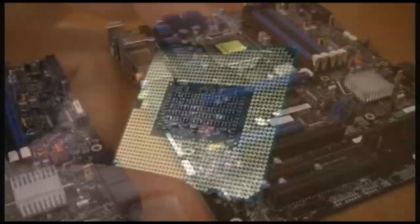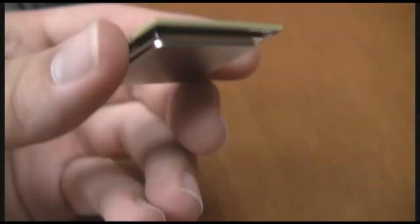Tell me about this new chipset and new socket — give me a rundown of what's going on with P55. So with P55 it's a whole new chipset for a whole new family of processors. It's also going to be branded Core i7 as well as a flavor of Core i5, and it's a new socket, LGA1156. You can see on the board that we've got a two-chip solution, so there's no more north and south bridge — we've only got this one little guy here that handles your IO and your clock buffers. I was looking for the north bridge cooler and I couldn't find it!